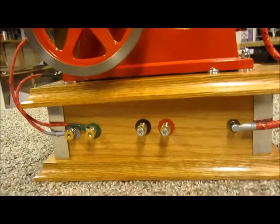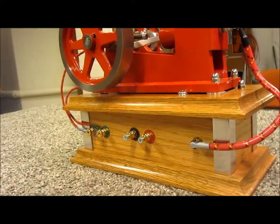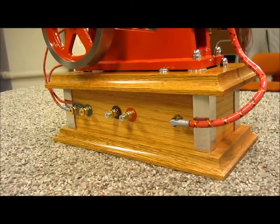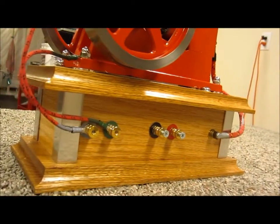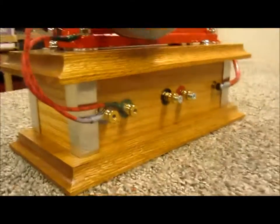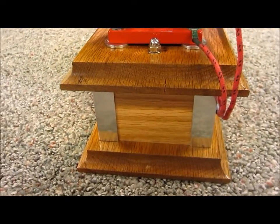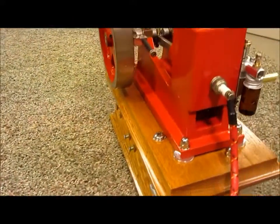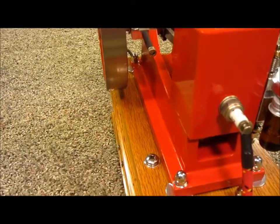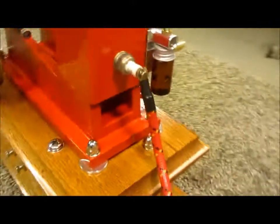Here are views of the box, which is made of solid oak. Inside is a six-volt Honda spark coil and also a condenser, which is just an automotive condenser. The rest of the ignition is supplied by a six-volt lantern battery which hooks up to these two terminals on the side, and the spark plug wire comes out from the coil.